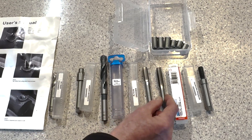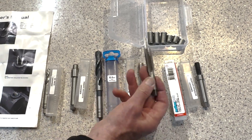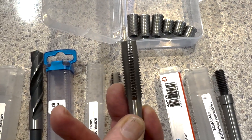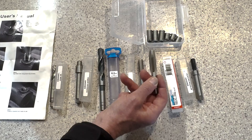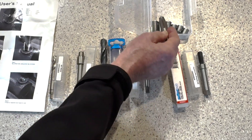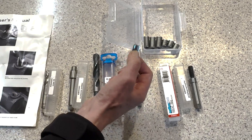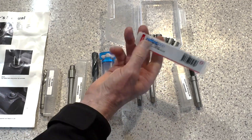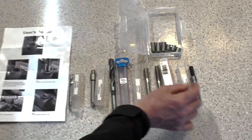Because I was being extra cautious, I also went and bought a Sutton's taper tap. You can see the taper on it — that'll start the hole easier and give a good bite. You probably don't have to do it, but you've got to finish with the bottoming tap to create enough thread length for the insert to screw in. Also note that the other tap is a chrome tungsten alloy tap — it stays sharper longer, but it's more prone to breaking, so just be aware of that.